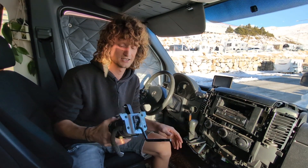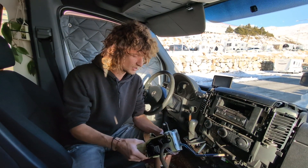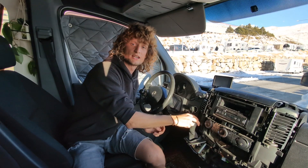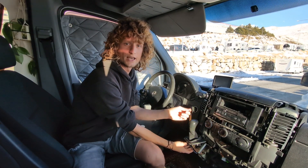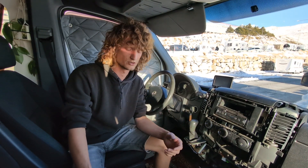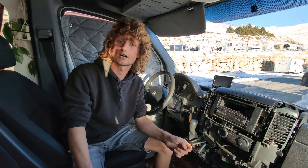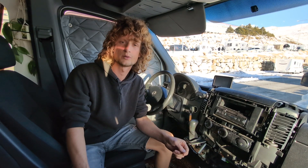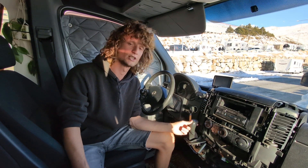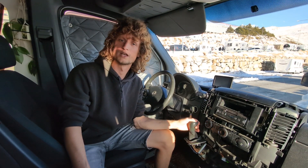It's an after video actually, but I want to explain it anyway. We could not get it out of park. There is a system in the selector which lets you manually get it out of park, so that's what we did and then the Sprinter drove normally. We went to a Mercedes dealer in Marrakech, Morocco, and they told us the same thing — that the selector communication module was broken, but they could not get a new one.